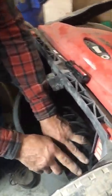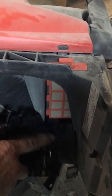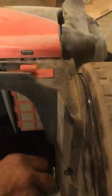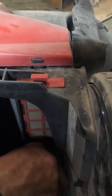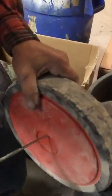Rotate your brush holder until you find the tab. When you find the notch, you'll see the tab — it says 'push' right here. Take your thumb, push until you hear a click and the brush will release.